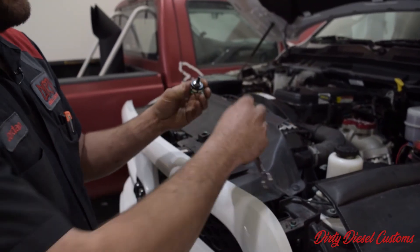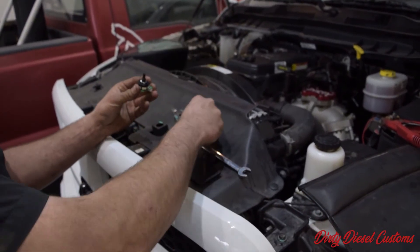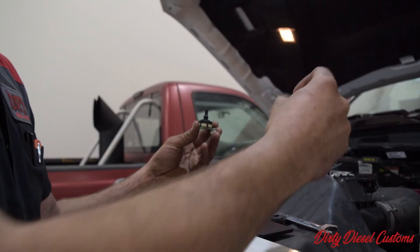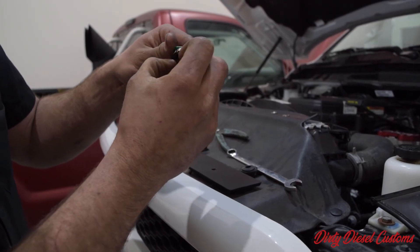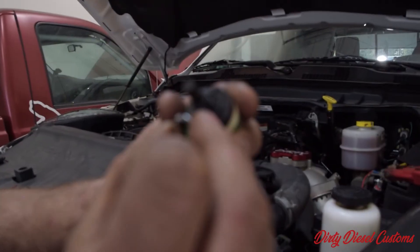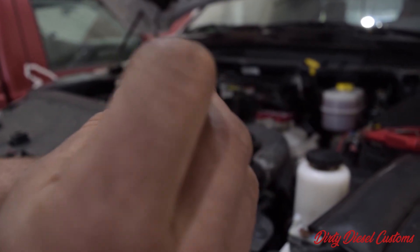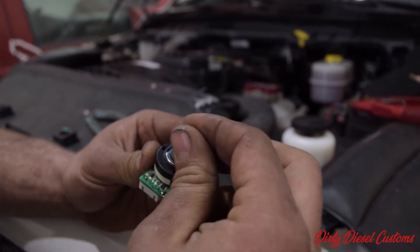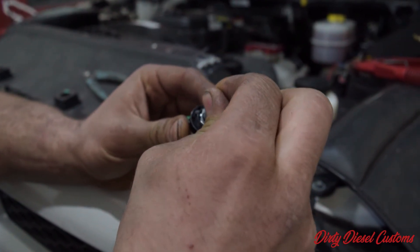Take the 13 mil, loosen the nut off the top, set that down, and then take the little lock washer off as well. In this case, because this is a 2013 truck, we're going to have it on a 4-position switch. Take out the little lock and on the side, on all these holes, you'll see the positions 1, 2, 3, 4, and so on. When you slide this back in, drop it onto the 4-position pin. To verify that's in the right place, all the way to the left is 1, then 2, 3, 4, and it locks.